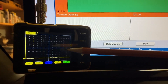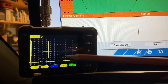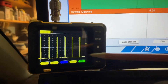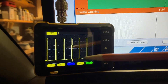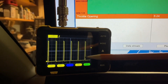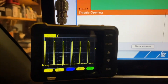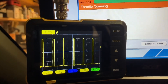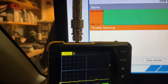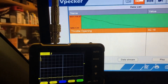At the full open position there are just a few spikes of closed drive to maintain the electronically 100% open position — it's not truly 100% open as the scan tool says; it's about 86%, with the throttle plate basically in line with the airflow. As I release the pedal at a reasonable rate you can see the closed drive come back. Opening fully again and releasing completely — you can see how wide it actually gets there momentarily. I'll open up and just let it close — a little bit of drive, and when I open a tiny bit the close signal is gone completely.